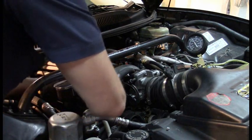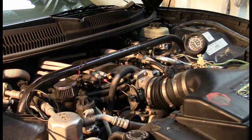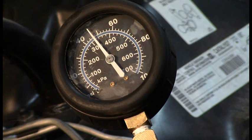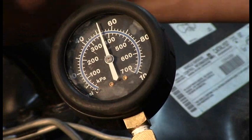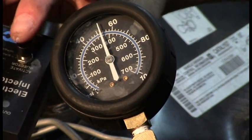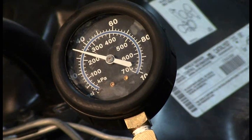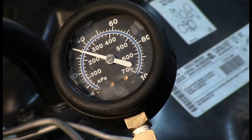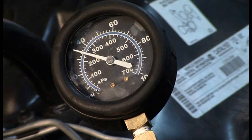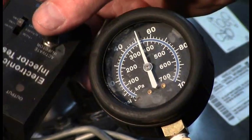If it's not compatible you'll have to rig up some wiring mechanism. I'm plugged onto my control injector now. You will of course have to manually prime the system by turning the key on and off. We're back to prime, and when I press the button it gives a much more healthy delivery of fuel - I think that's a better way to assess. Looking square on it reads exactly 34 psi. Every injector should read exactly 34 psi. Let me put this on one more control injector on bank two to verify accuracy, then repeat this test on bank one.